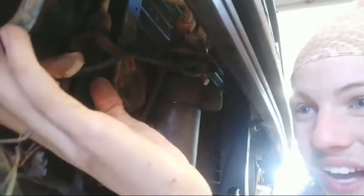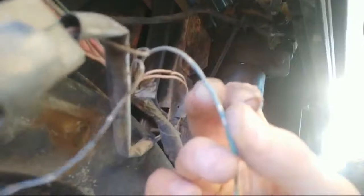So, with the bull bar on, we found the wires were all behind this tube here and potentially rubbing. So I don't know if you can see it, but there's a little bit of a rub mark right here, and that is where the short occurred. Now I've taken off some tape, but this is the section right here, right there, and I hate this focusing crap. It doesn't like to focus very well, does it?